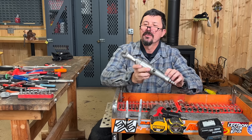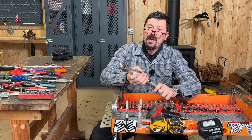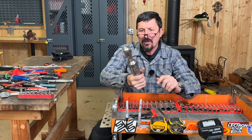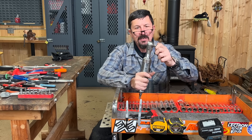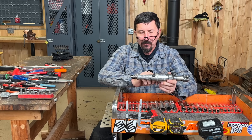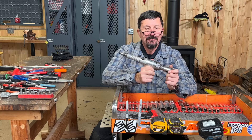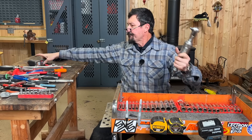I remember the blood money it took to buy this air ratchet too — I bought it off the Snap-on truck, old school, and that'll twist your arm off. But I found especially when working underneath this is too big, you can't get it in tight spots. Sometimes the air ratchet is the only tool — it's a hateful miserable thing to use, a wrist-breaker, but when you need it you need it. The cordless versions I know are pretty good — convenience is nice — but are you going to have it in 25–30 years? Will your grandson use it? Probably not. But these air tools will last.